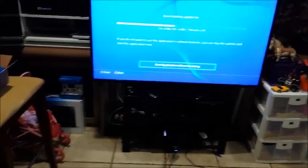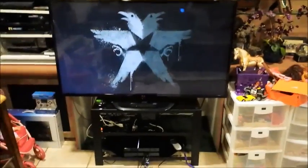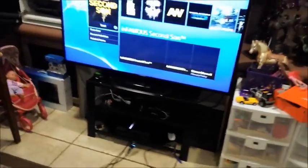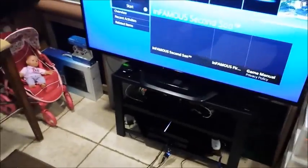Six minutes left on the update, let's start anyway. Everything's working — I just wanted to make sure the disc was reading. That's it guys. I definitely recommend doing it. If you're going to play hard on your PS4, you're going to have to change the thermal paste eventually. You should get three years out of Arctic Silver 5 before you have to do it again. The stock thermal paste — after six months, she's probably already running hotter than she should be. After you do it, give it like an hour or two and then feel the air coming out of the back. If the air coming out of the back is super hot, what you just did is working. If it's still coming out pretty cool, it's not working — but chances are it's going to work because the Arctic Silver 5 never fails.